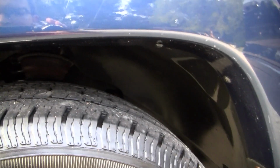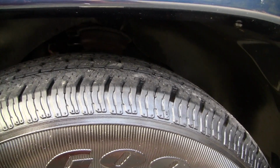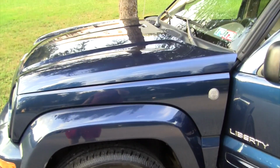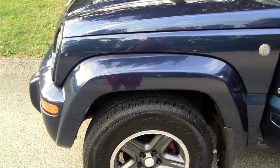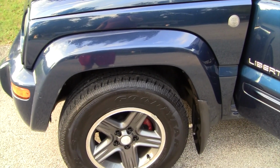You probably can't even see them. The Detroit Axle struts I would say are okay, but the only complaint I had about them is that the length was different, so I had to do some creativity to get the front ride height to where it was supposed to be, and move the sleeve around on the knuckle to where it needed to be in order to get the ride height back.